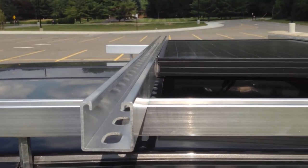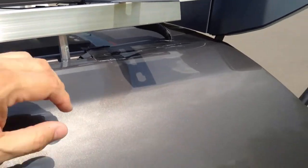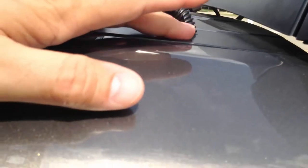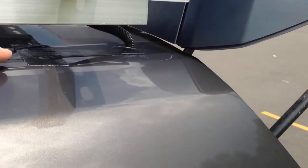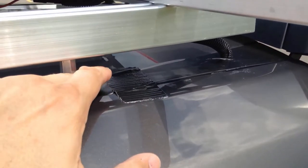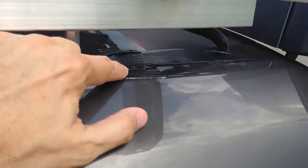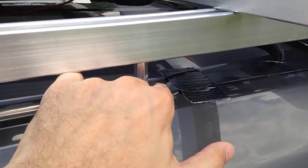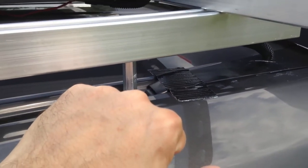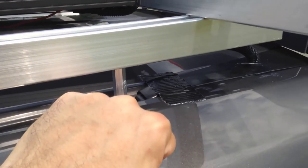That's after 4,400 miles at 80-plus miles an hour at different times, so it held up well. I ran the wires down through a hole that I drilled in this little plastic piece in the back. When this is mounted and you have the rubber piece in place, the front of it is captivated and can't go anywhere. Unfortunately when I pulled off the rubber strip I discovered it's no longer captivated, so to get out on the road for my trip I just put some black duct tape on there — it held fine, but I wanted a more permanent solution to build in the off season.